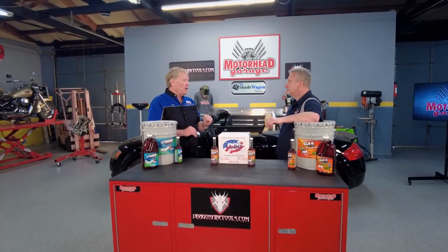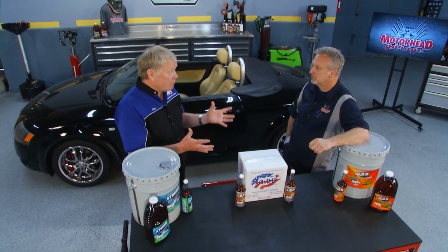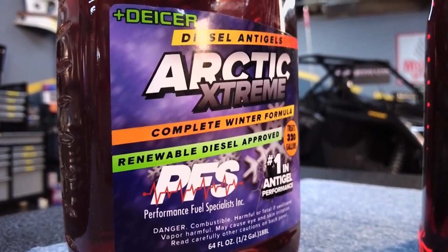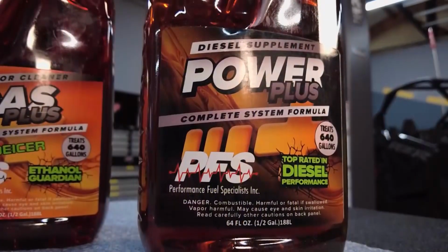Winter gasoline, diesel is the same, is different than summer. They need an additional product like butane to help your engine start in the colder weather. But that creates problems in the summer, which would be primarily vapor lock. So buy the fuel for the season which you plan on using it. That makes a lot of sense.